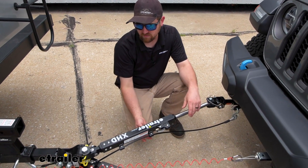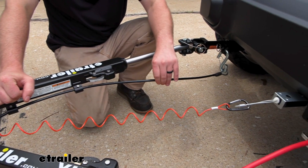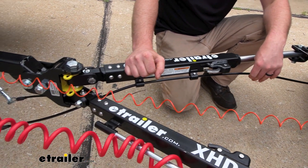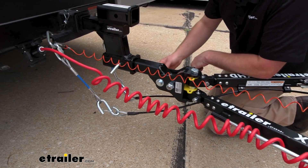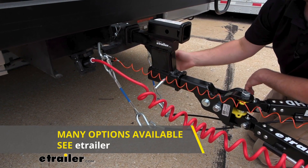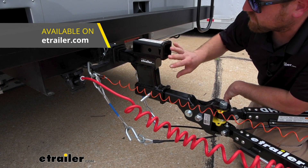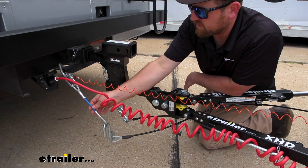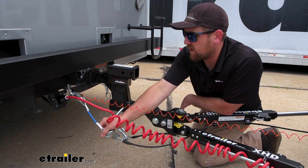This also comes with safety cables included, which is cool — it's one less thing you don't have to worry about picking up separately, and you know they're the proper weight capacity and style. In our case today, we had to use some extenders because these did fall a little bit short, but that's partly due to the fact that we have this big high-low assembly. They wanted a dual one so they could put a bike rack and other stuff in there, which really spaced things apart. So if you run into a situation where they fall a little short, extenders are a way to solve that issue.